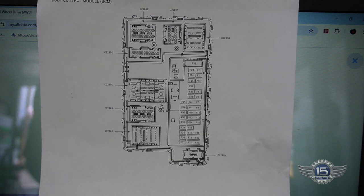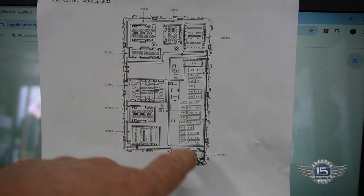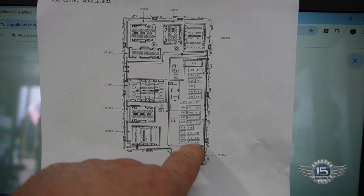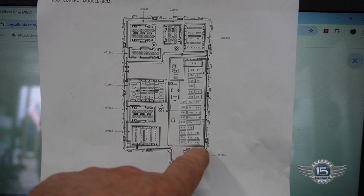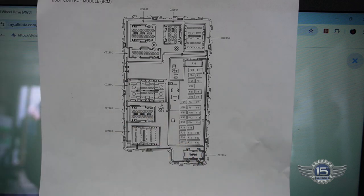Here is the schematic for the BCM. It's under the left side of the instrument cluster above the driver's feet. So we're looking for fuse F21. That appears to be one of those triple fuses and it's the left side of that triple fuse. If you've ever seen those triple fuses, they're basically a regular fuse except there's three legs coming off of them — hot side coming up the middle and then it branches off to two different circuits on either side. We want to check the left side of that fuse for 12 volts.